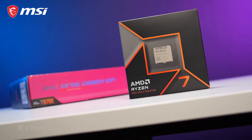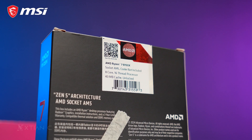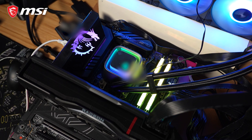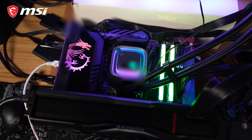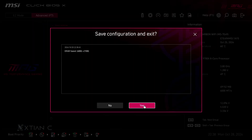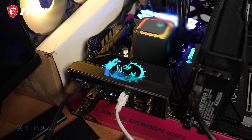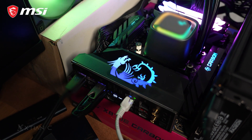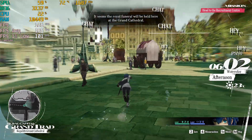For those who don't know, this is one of AMD's newest CPUs featuring Zen 5 architecture. It has a total of 8 CPU cores and 16 threads with a max boost clock of 5.5GHz and a base clock of 3.8GHz. There's no cooler included, so we'll be using a 360mm AIO aftermarket cooler on our test bench. For the other parts, we used Kingston Fury Renegade DDR5 at 7200 MT/s in a 48GB kit, running at 6000 MT/s — we tried booting at 7200 but it didn't post, so we settled on 6000. We also used a Radeon RX 7900 XTX for the GPU, a 2TB NVMe for the boot drive and games, an 850W power supply, and Windows 11 Pro build 24H2.